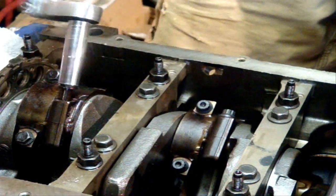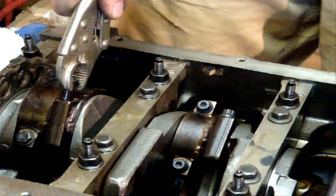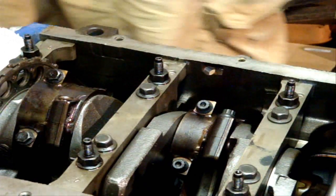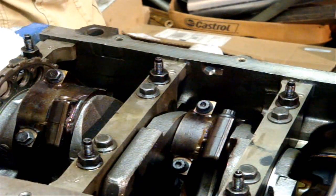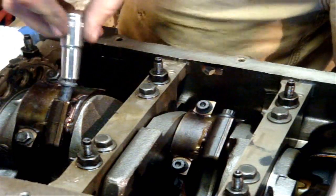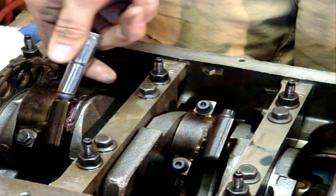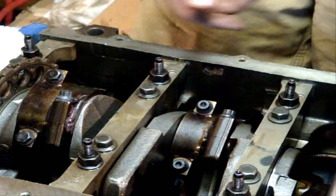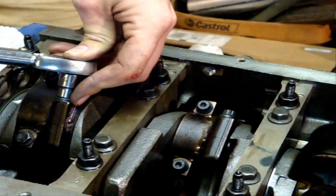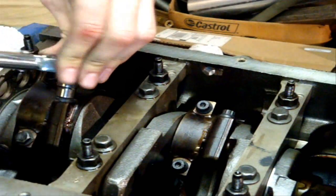From what I did, there's a lot of reading on this and it's like 50-50 — half will tell you to get your rods resized. I'm half wondering if that's just old school thinking. My LS1, the motor I took out, had its rods resized. But interestingly, when I took the rods and pistons out, the bearing showed top and bottom wear consistent with what some people claim happens when you don't resize the rods. I think if your tolerances are good, the tune is good, and the motor was built reasonably well, you don't have a big problem unless something is really out of whack.